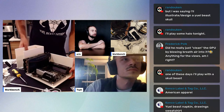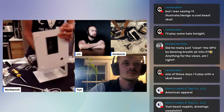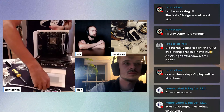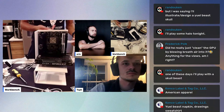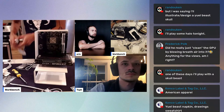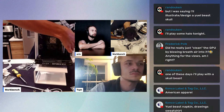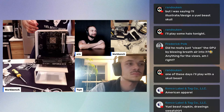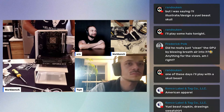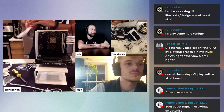And then before I put on the backplate, I should get my cables plugged in so I can have those routed. So this will be my, okay, that's for an 8-pin. Let's do the 24-pin first, because that one's kind of the annoying one. One white 24 pin going in. Okay. This is the first build that I'm going to see that's using extensions. I mean, it works with the backplate.